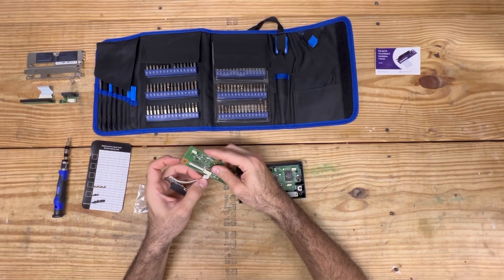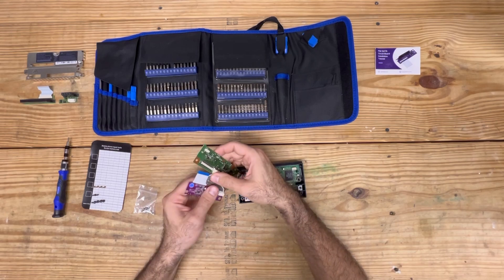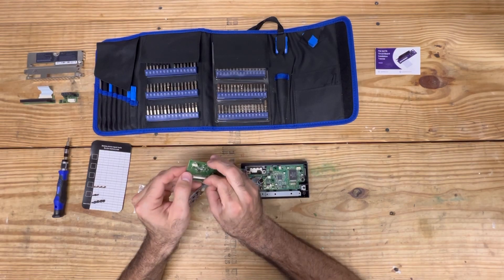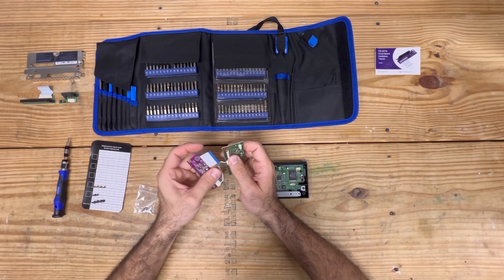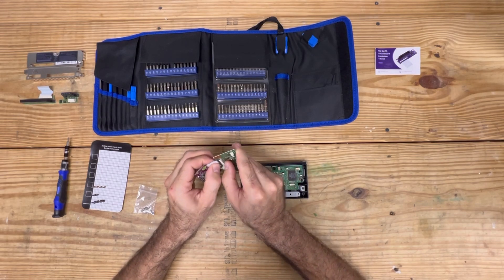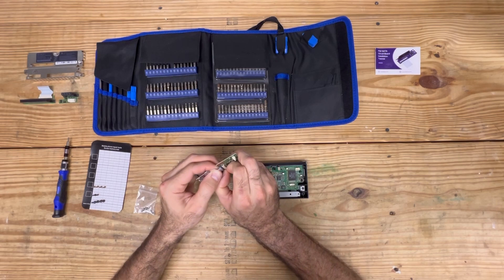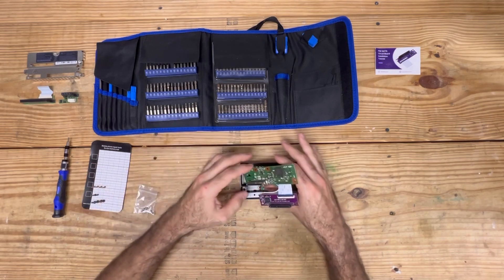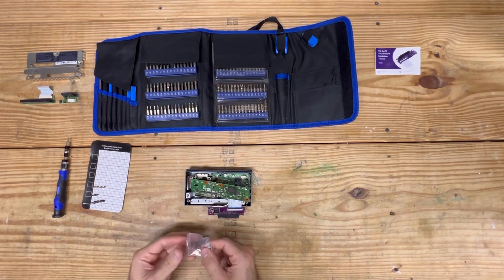We're going to reuse that cable on this adapter here. I'm probably going to hang on to those two other pieces just in case — it is pretty hard to find original pieces for games that are getting older now. So let's go ahead and place this on and twist that around. And just want to be careful with the ribbon cable when you're putting it back in. You want to pull this black retainer back to allow the ribbon cable to slide in very nicely. While pressing up against the ribbon cable carefully — it is delicate — you want to push that black retainer back in, which is going to pinch this cable in place. And we've essentially swapped out the IDE for the SATA connector.